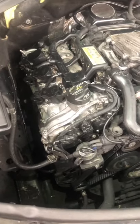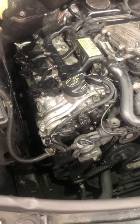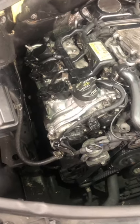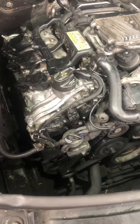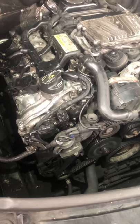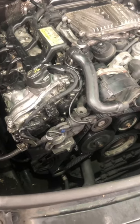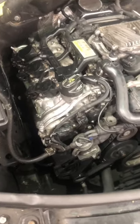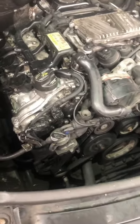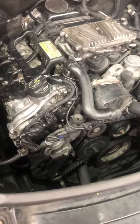I have to wait for the silicone to cure because this is Mercedes-Benz silicone — this is not an RTV high-temp silicone like the previous guy used. This is actually Mercedes-Benz silicone. Remember, this is a Mercedes, so parts are completely different and repairs are completely different than when you work on a Honda, Toyota, or Ford. For example, this could easily crack instantly while you're doing a job if you over-tighten it. You have to understand the product you're working on before you start, and if you don't, that's okay — do a little reading, a little research, ask someone before you touch the customer's car.